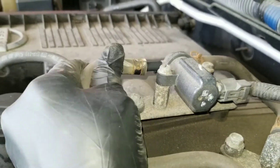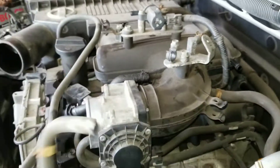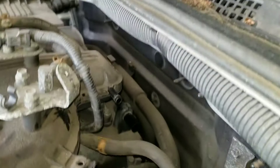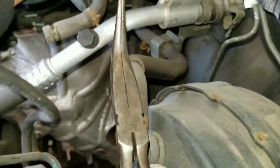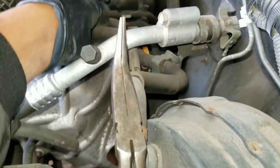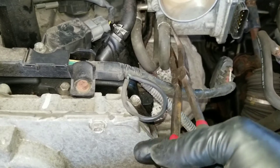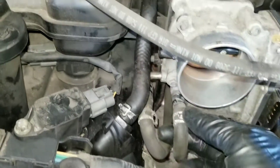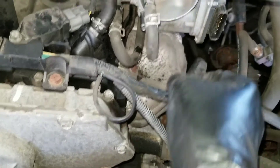Got the clamp, pull back, pull the wire out, snap it from the hook right here, and just bring this back out of the way, let it sit right here. And this line — this is already off, it's just hanging there. Just bring this back and tuck it out of the way. Back in the front, get these two hoses off, pull that back, pull this back — you should be able to pull them out. You may see a little coolant, but it's not enough that you gotta set a bucket or anything.